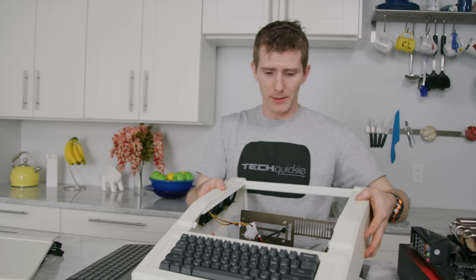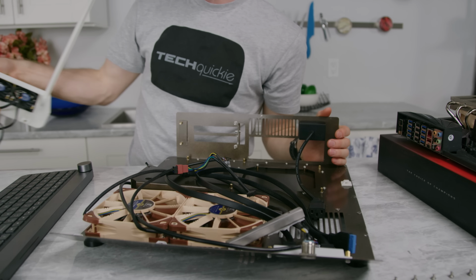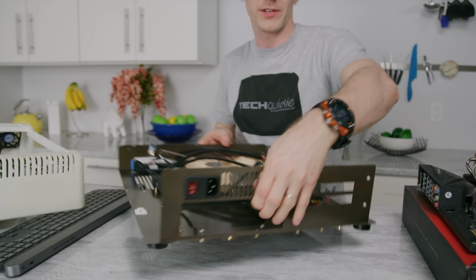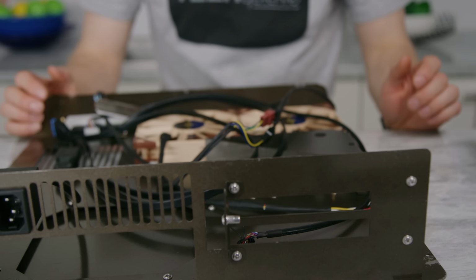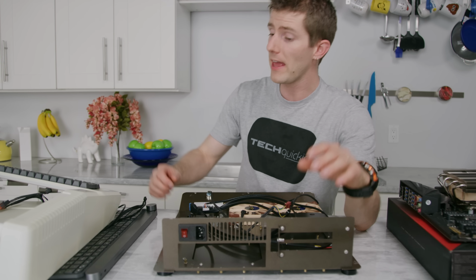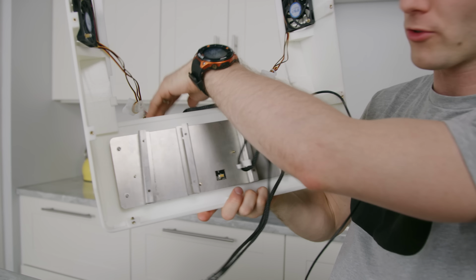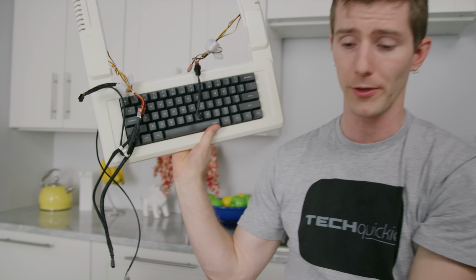Getting it open right up here, hardware compatibility is a bit of a mixed bag though. So we've got full ATX support for our motherboard. Here, you can see that the length is right, but we're confined to small form factor territory for expansion. So that means a single dual slot opening on the rear for our GPU, and then just 2 2.5-inch drive mounts, which on this revision of the design are mounted right here directly under the keyboard.